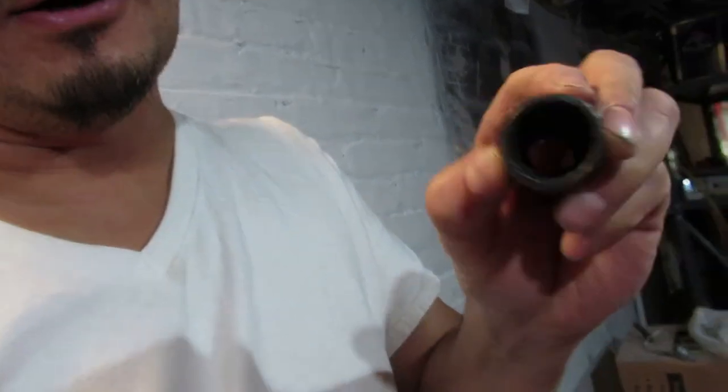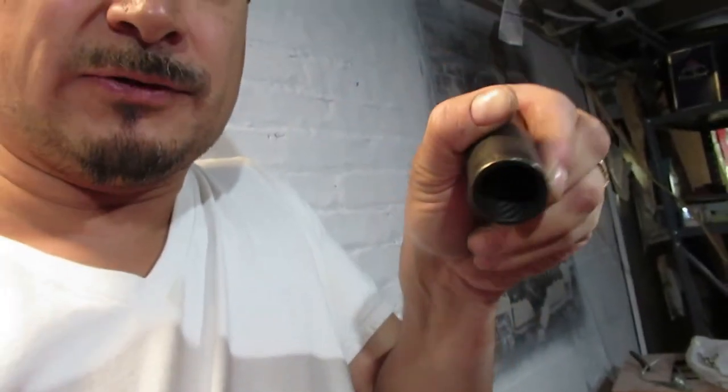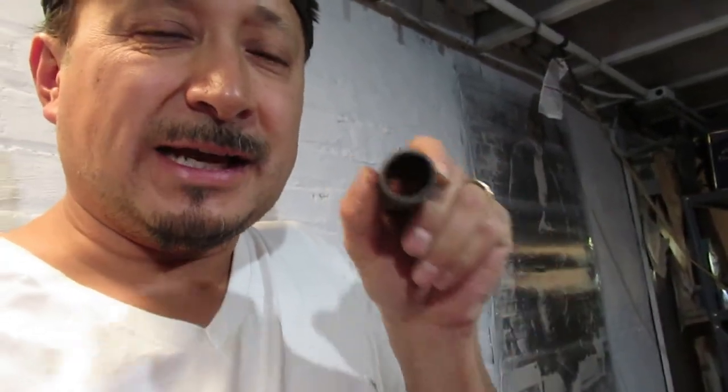So when you're trying to reverse it off, the threading on this is biting down and making it tighter. So these are pretty dang cool. Well, this is the opposite way right here. If you're trying to get it off in reverse, as you're pushing down with the impact gun, this right here is getting tighter and tighter on the bolt. So you could even stop with the impact gun, take it out, and then put in a tension bar, torque bar, to try to get these out.